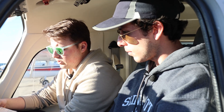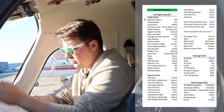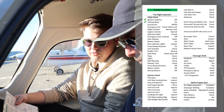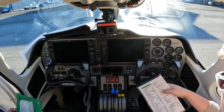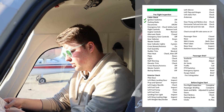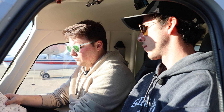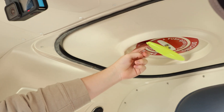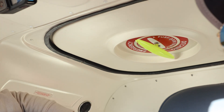So once we make sure everything's off and everything's clean, we can actually start pulling out our checklist and run through it. Ignition switches are off, which we've confirmed. Parking brake is set. Documents for the aero — we saw them earlier down in the bottom of the door. We'll double-check that we have our airworthiness or registration. We have a POH in the back seat, and the weight and balance is also in the POH. Emergency exit: we have one emergency exit in the plane — the center door hatch up here. This little wire makes sure it doesn't open on accident, but it's set up so that it'll easily snap if you need to open it in an emergency.